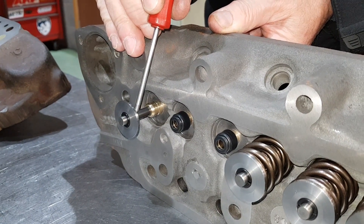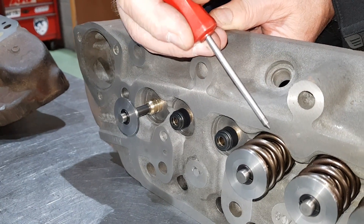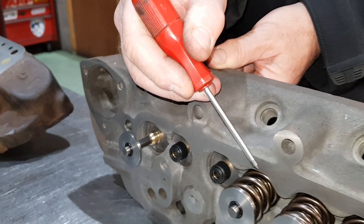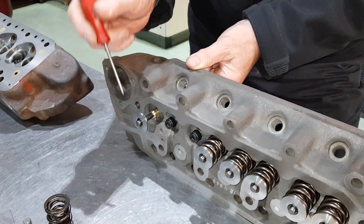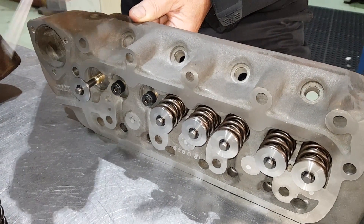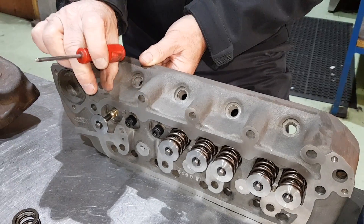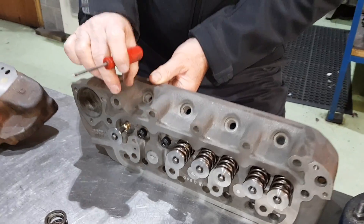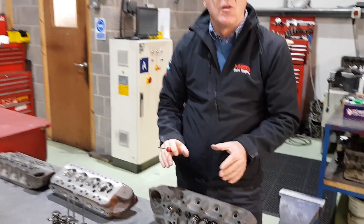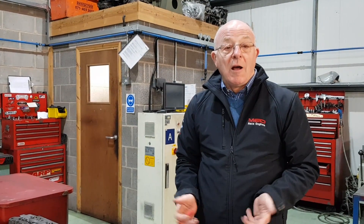So in other words, when it's actually in place, that is the fitted length of the spring. If you find your fitted length is too long, we keep shims to go onto the spring platform to get it correct. That must be done to get the right tension on the springs for the application being used. Hope that helps.